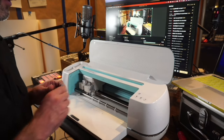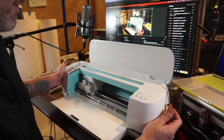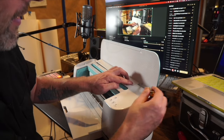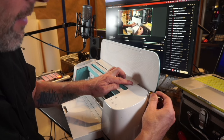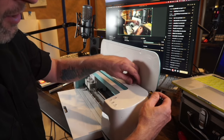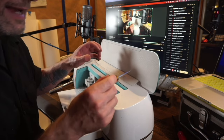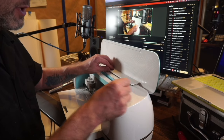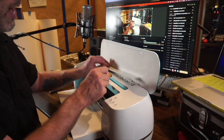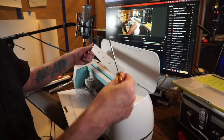The first thing we're going to do is pry off this panel right here. Find the very side of it — there'll be enough space to get a screwdriver in right in this area and you can tweak it in there and start to pry it up. This piece is glued down so it'll crack and pop — it sounds harsher than it really is. Once you peel up the inside, work along it and eventually pop up each peg that fits in holes. It'll pop up if you're gentle.